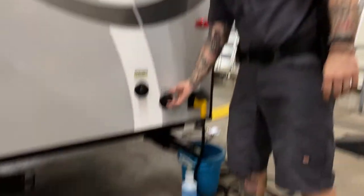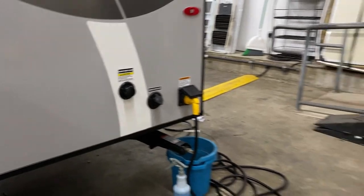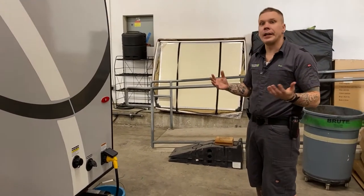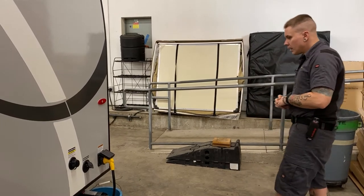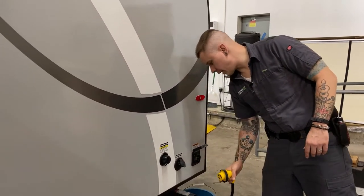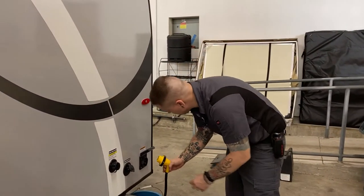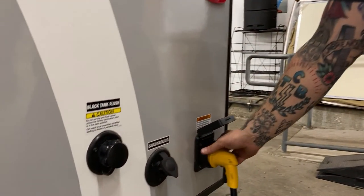There is a cable satellite inlet here — a standard RG6 cable fitting. Higher-end campgrounds and KOAs often provide cable service; this is the inlet for that, and it's a pass-through to the designated TV area. The 30-amp, 110-volt power supply cord is 30 feet in length, plugs into the camper only one way, and once fully seated you give it an eighth-inch turn to the right to lock it in, with a secondary collar to screw down further.